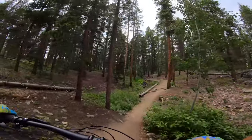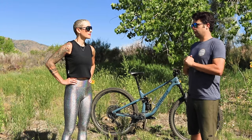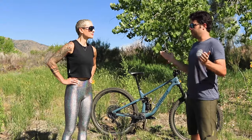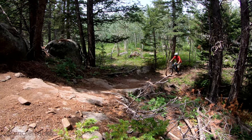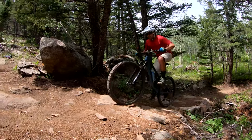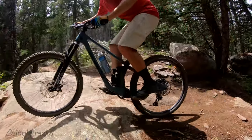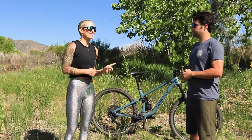I also found I had to be very aware of my foot placement around big rocks and roots. I tried removing air pressure and backing out the low-speed compression to make it as soft as possible, but it's still a very firm, progressive bike. Where the suspension suffers on climbs is tracking through really rocky sections — rock, root, rock, root sequences get more tiring than on some other bikes. But on a smooth, buff climb it feels like a rocket.